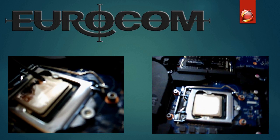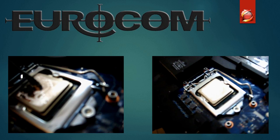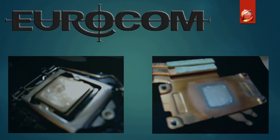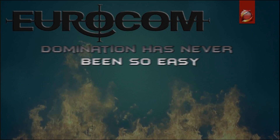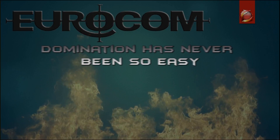It's important that you not get this on any kind of electrical contacts or on aluminum — it will cause damage in either case. It's conductive and it will erode aluminum. And there you have it. In less than three minutes, great examples of why liquid metal thermal paste is the way to go, and how to properly apply it. Hope you found this video informative. Have a great day.